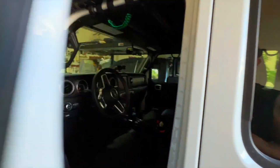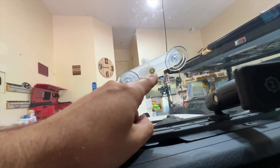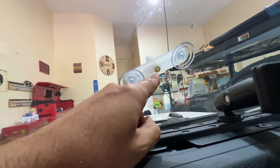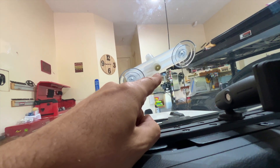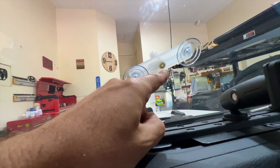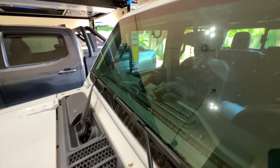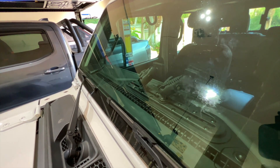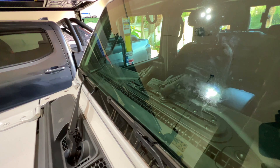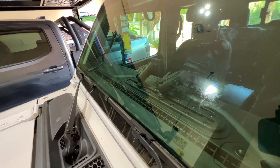I've let it sit for the required amount of time — 30 minutes. Looking from the inside, you can still see the crack right here. I'm going to pull this thing off and take another look. The resin isn't cured yet, so maybe that will go away upon curing. It actually doesn't look too bad. The next step is to put a drop of resin over the hole, place a thin film over that, and then let it cure in the sun.